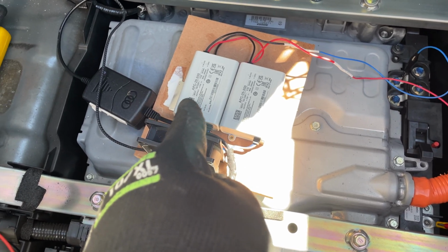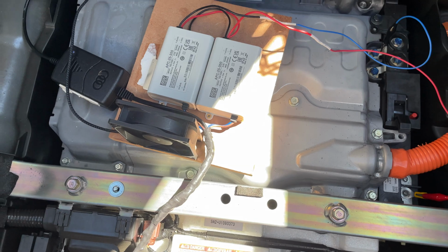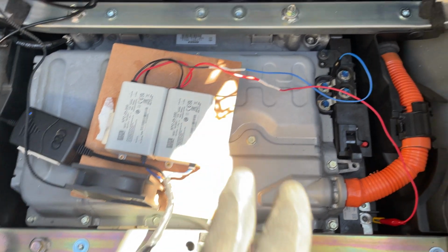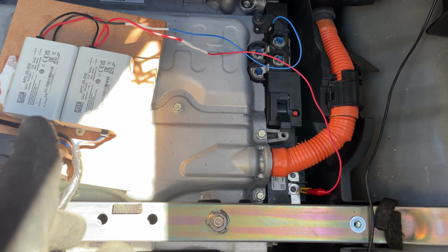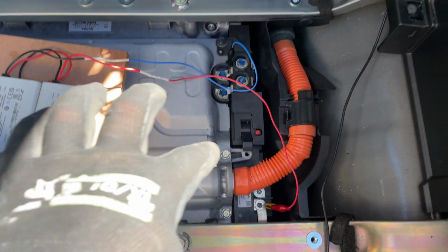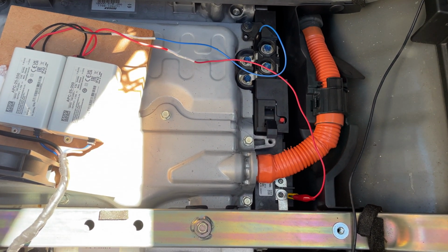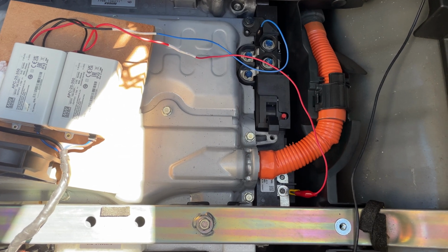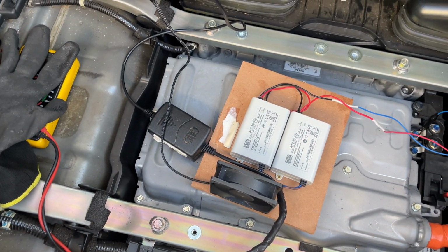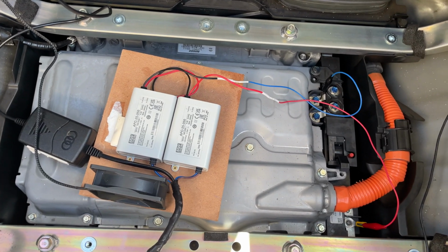Once that is on, you can use the multimeter, verify that you've got voltage. In my case, I get about 153 volts. That's the 70 times 2 on an off-load voltage. And then once you've got power to that, then press red button in, flip down the IMA pack to turn on the IMA, and from there it will now start charging. And then you leave the process for 24 hours if you can, and that should slowly bring all the cells back up to balance.